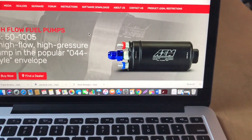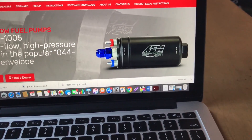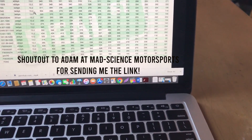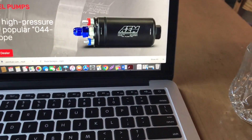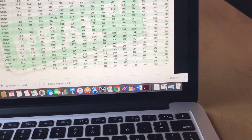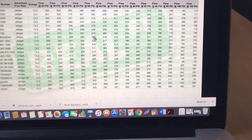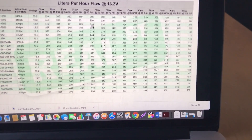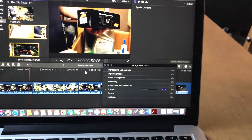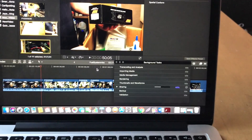I was just editing this video and figured I'd give you guys a little more info on this pump. Here it is on AEM's website - it's a 501005. The reason I picked this pump was because I looked at Real Street's test of all these pumps. This is a conventional 044-style pump, which is the really popular Bosch. At 60 psi where we're going to be at with the sniper, the Bosch did 280 liters per hour whereas the AEM got 320. Here it is on Summit - it's $152 US. Strongly recommend this for people wanting a budget-friendly inline fuel pump that's going to do the job and support enough horsepower in the future.